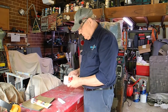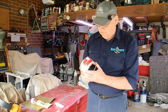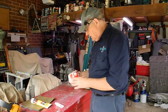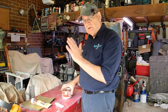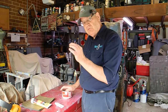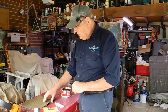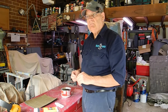Right, okay, so first thing we need to do is use a fine filler. I'm using the elastic filler, Weiss, and so we're going to mix up some of that and cover the whole overspray, the little droplets, cover them with this fine filler. And then I've been given heaps of sandpapers and we start to rub that back.